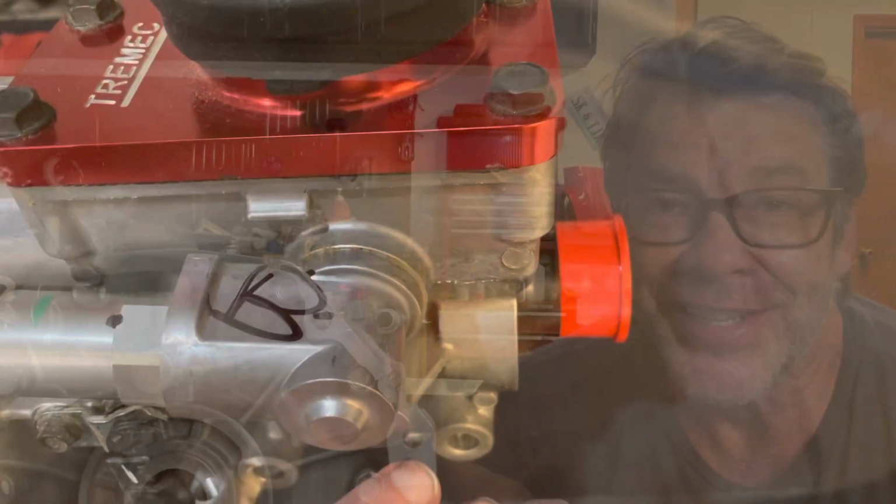So that's much better there. That's just going to mean it's going to handle more power, right? It handles 700 foot-pounds, and I think this is underrated. I know guys that are running TR6060s, and the internals are based off of the TR6060, which came in the modern Camaros and Challengers. They are running well over 800 in a lot of their setups, turbo and blower setups, and E85. So they're pushing these transmissions pretty well. I feel like my research says the 700 foot-pounds is a little underrated. I feel like this thing will handle more.